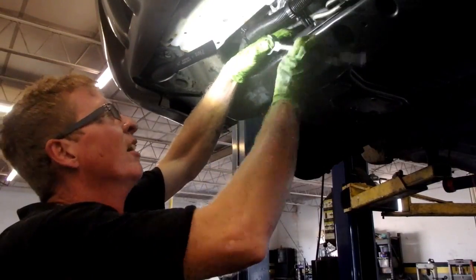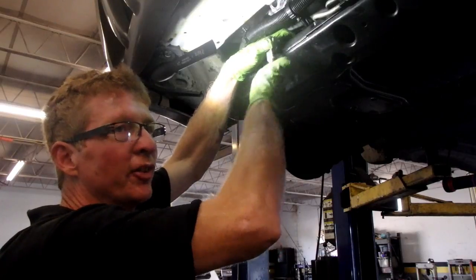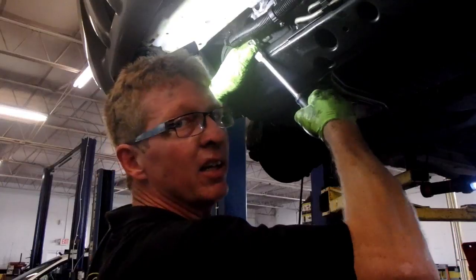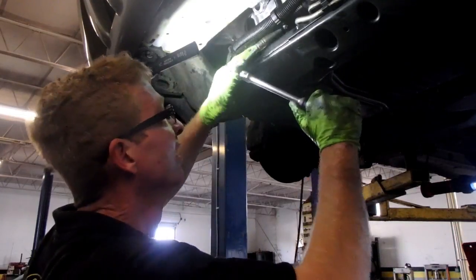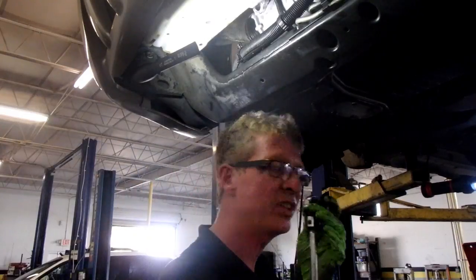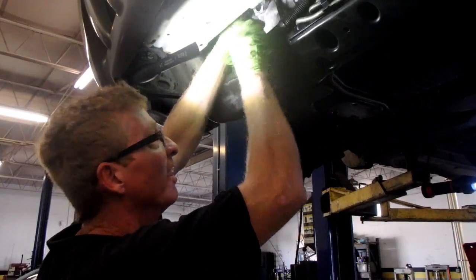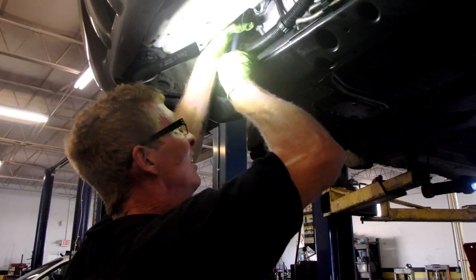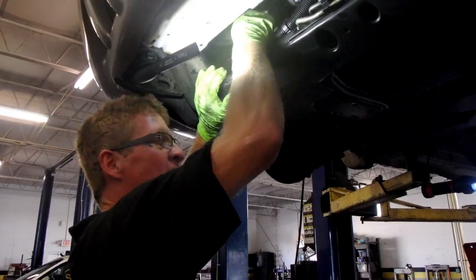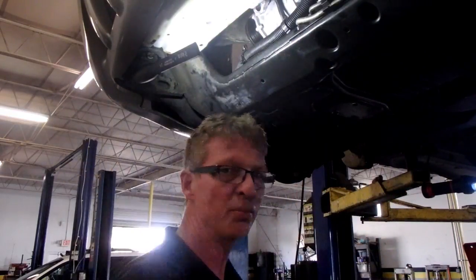Up there. I'm putting the bottom bolts in. I said there's just 3 bolts in this compressor. This is not a bad job. I just want to get these tight. Now, a regular 15 and a 3/8. You cannot get in there with a ratchet. There's no room. Alright, so the compressor bolts are tight.